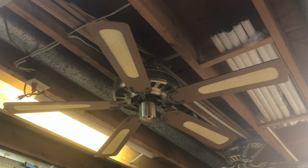The fan uses a transformer to control all those speeds, which pretty much fills up that entire elongated switch housing there on the bottom. So, adding a light kit to the fan will definitely be quite difficult unless you used a 4-arm fitter, which you can make the splice in the fitter itself. But like a single globe fitter or whatever, that'll be much more difficult.